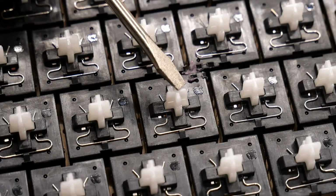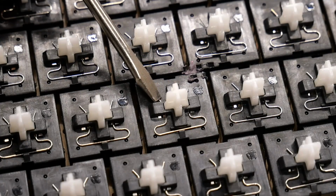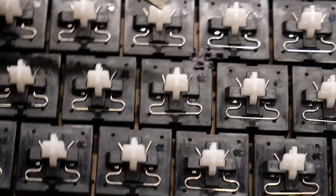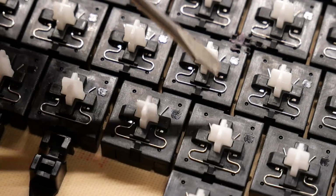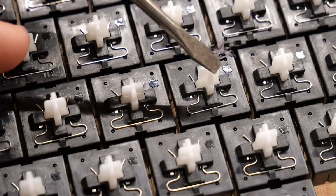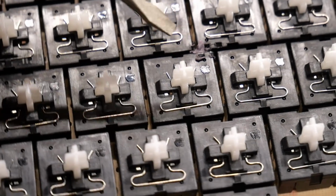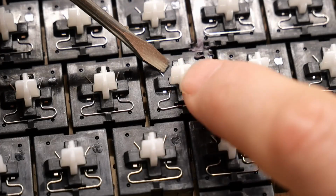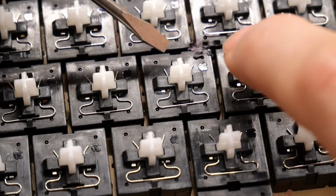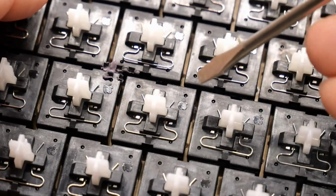Down on the workbench, we can get a much closer look at how this works. So this spring is definitely part of the tactile switch. That gives this slider an actual tactile bump. And it looks like when you push it down, it catches up on the right side. See it moving? And it seems like the one on this side is for the upstroke. See how it really clicks there on the way up? So if I hold this over to the side and push down on this, then sure enough, on the upstroke, there's no more bump. Also fascinating, check this out: little Apple logos on every single one of these switches.